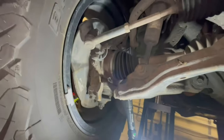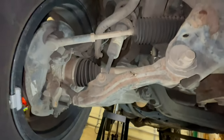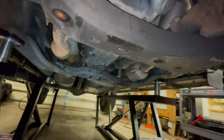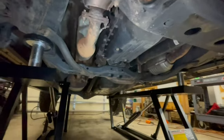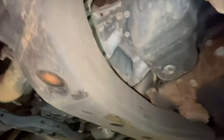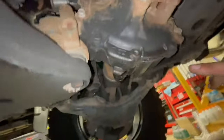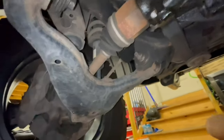There are a lot of things that could use a little bit of attention, but for a 2006 with 195,000 miles on it, this thing looks really not bad at all. Right there is where the transmission meets the engine block — it's dry, so our rear main seal looks great. There's a little bit of seepage from the front differential — actually more than a little — but we won't have to worry about that just yet.